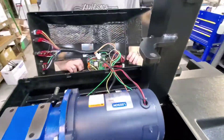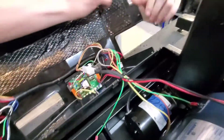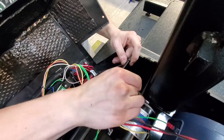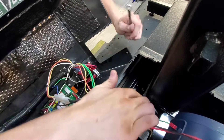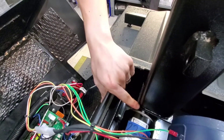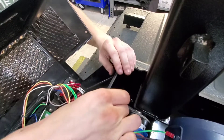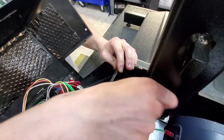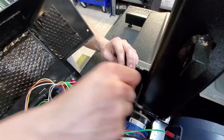We've got the electrical cup and it looks like we've got a nut there. So you want to take your 3/8 wrench and get that one pre-loosened. You won't be able to completely loosen the nut because it starts running into the uplift housing. But if you don't loosen that before you start loosening the other three, it's going to be a lot harder to get this off once we're in the other service position.